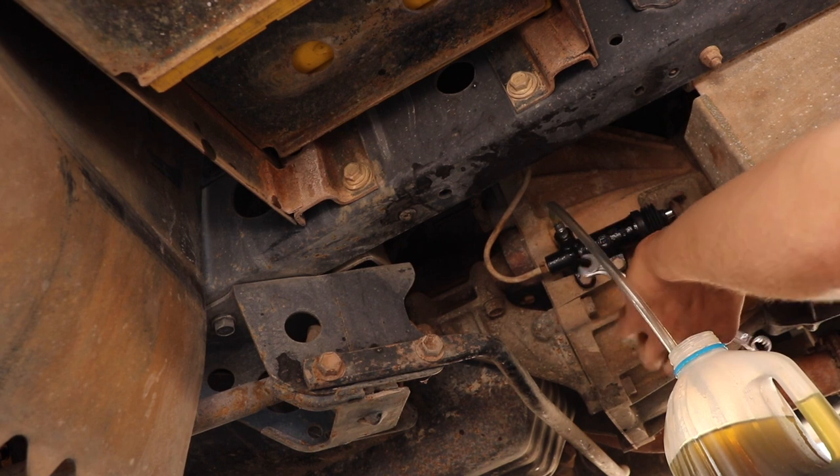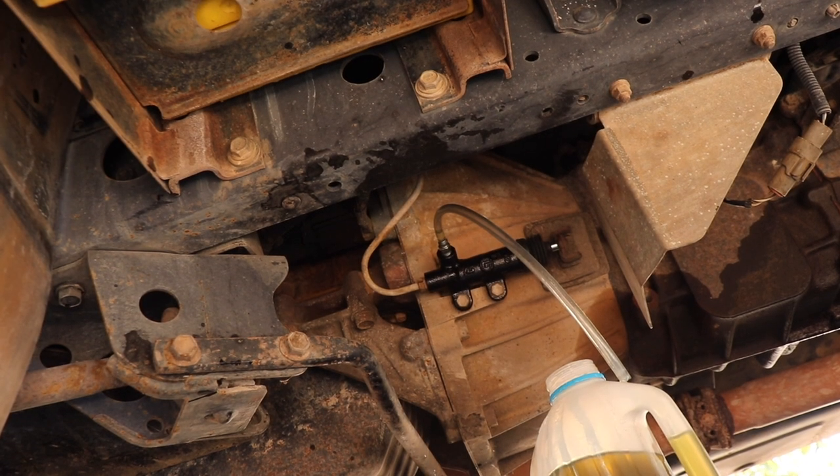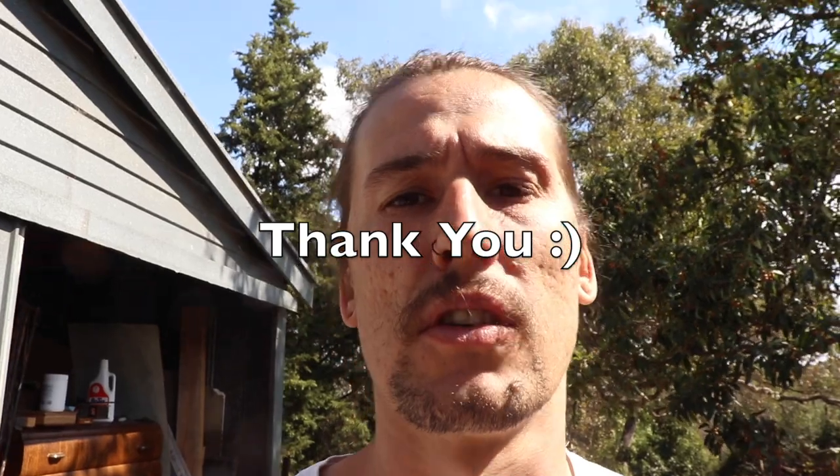We do this back up, and now when we press on the clutch you should see the slave move. I'd call that a success! We have the clutch pedal back - we had no clutch at all because the master cylinder just wasn't holding pressure. But now we've done that and bled it and we've got the clutch back. The clutch feels nice and heavy, we can change gears even stationary. We'll take it for a test drive and see how it goes - it feels 10 times better than it was. Hope you found something useful in this video - if you enjoyed it give it a like and subscribe for more, because we're doing lots more work on the coaster.